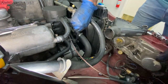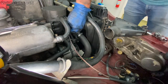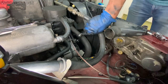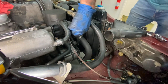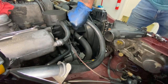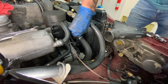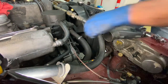That's better — you don't want to go too tight, just a little bit. There should still be some deflection on that belt. It's important that you can't just start tightening the adjustment bolt — you have to loosen the mounting bolts first, otherwise you'll break the bracket. Don't just start going on the adjustment — you gotta loosen those up first. A lot of people don't know that.